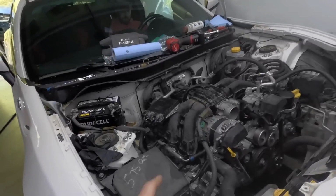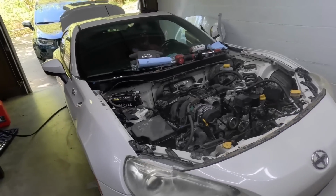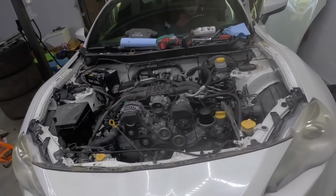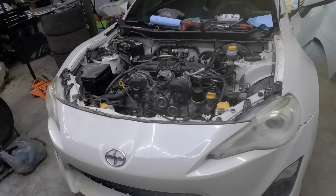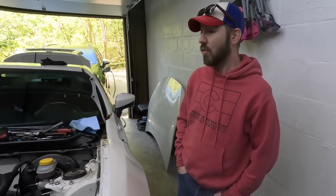I'm plugging all the injectors to see if she flooded, because a lot of gas got in the cylinders when we pulled the intake manifold. I feel like if it had no compression or really low, it would be starting a lot faster though, you know? Like cranking faster.